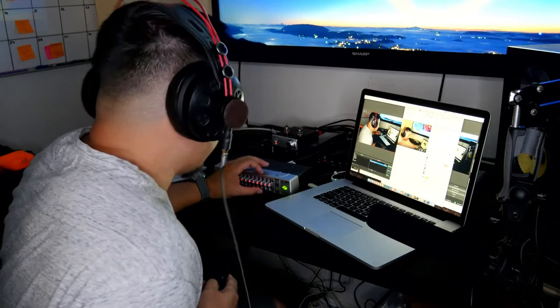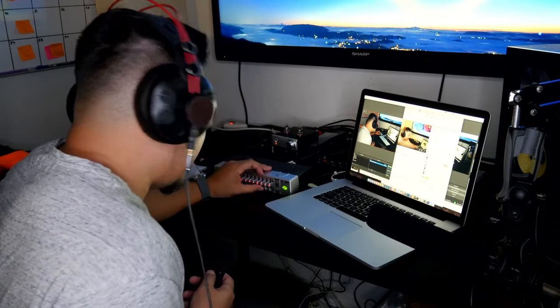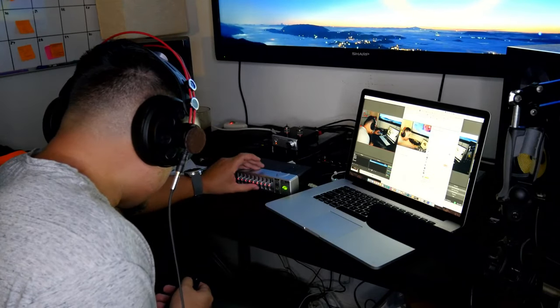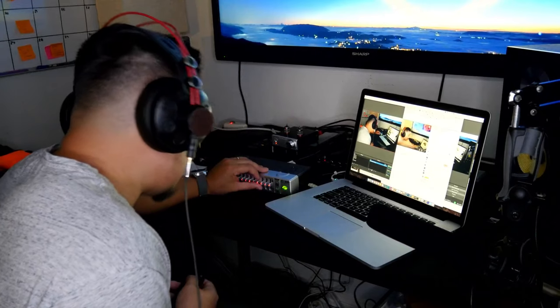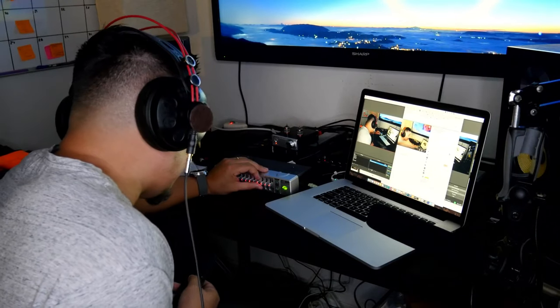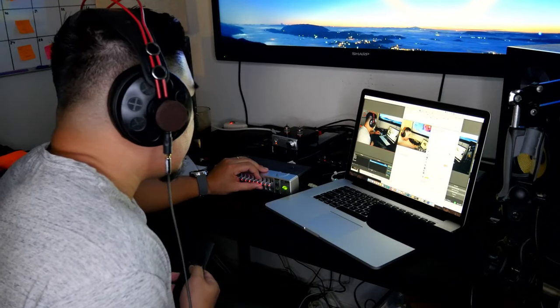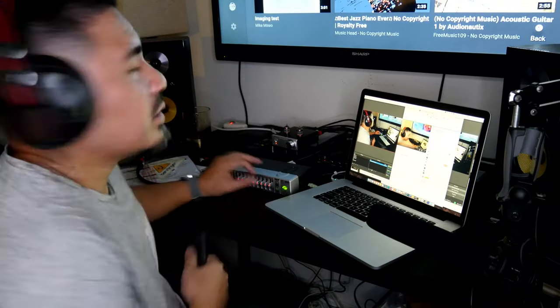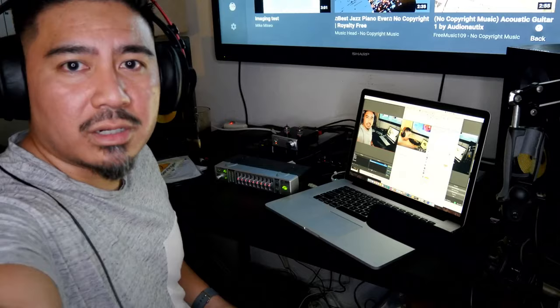You guys watch my review on these speakers? You remember I was saying that there's a dip around the 3 kilohertz range? So I could fix that right here. It was about 6 dB, so it was a pretty big dip. And I think you could notice it easily on this song right here. This song, the Jabberheads one.